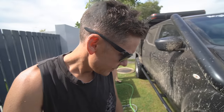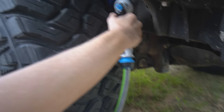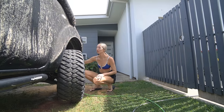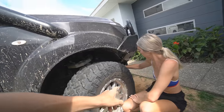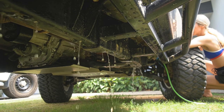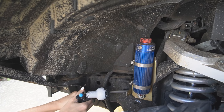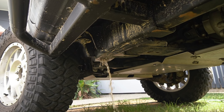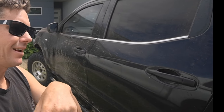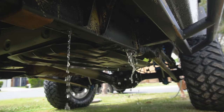Sending the water back the other way down the chassis does help. If you turn the wheel, the chassis has these holes — aim your hose right in for a couple of minutes and it'll eventually become clear coming out. I like to do it from both sides because it gives a different angle. When you're doing it yourself, just go front, back, front, back — the sand gets pushed left and right until it comes out and stops kicking back at you.